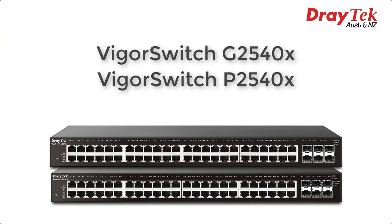What's going on with the name? Looking at Draytek's naming convention for switches: the G at the beginning means gigabit, P is Power over Ethernet, the next number 2 tells us we have Layer 2 management — in this case Layer 2 plus — 54 means we have 54 ports, that's 48 gigabit ports and 6 SFP slots.